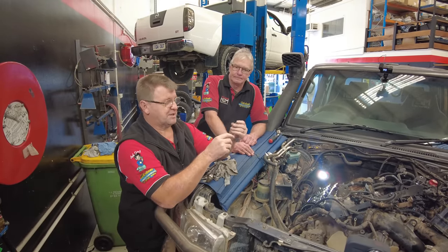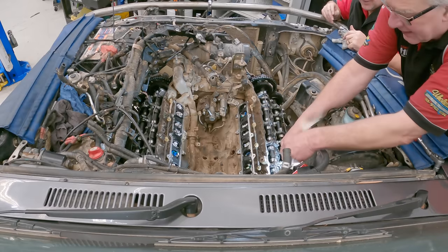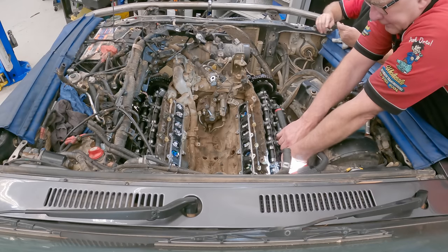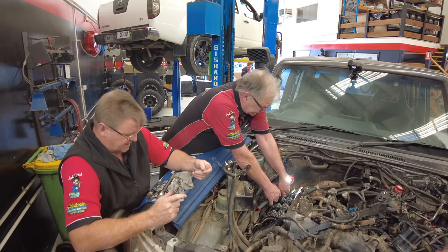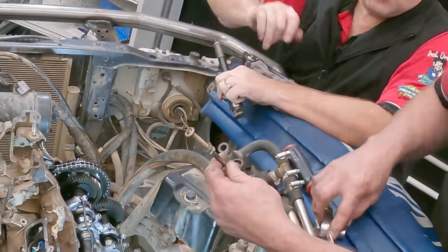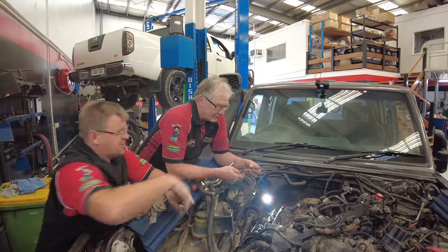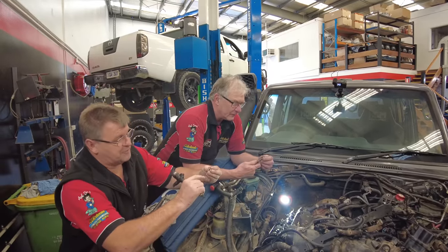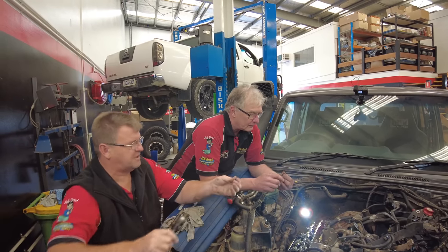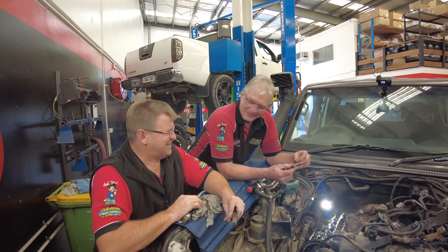Greg fashioned a tool to try and screw the washer out — a bit of stainless rod from his toolbox with a bolt welded to it, the exact same diameter that bites into the washer without going into the head. He wound it in and wound it out. We haven't damaged the seat it's sitting on, which is critical because a new injector and new washer need to go back down in there. We're going to show that to Andrew and show him this video — first time for us. Sometimes different people have got different ideas on exactly how to go about different problems.